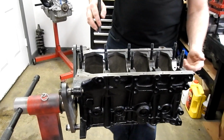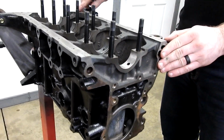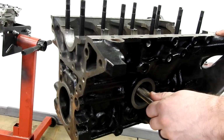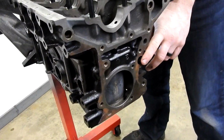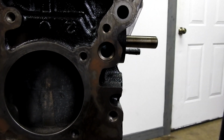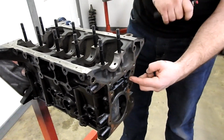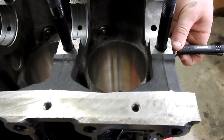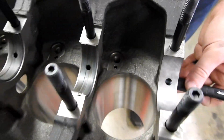On the BP motor, the oil pump inlet is here, and it sends oil through the block to the oil filter. It goes through the filter and back in and enters this main manifold inside the block. And we can see light coming through that manifold, maybe all the way down. From this one main manifold, we have 5 runners that come up to each of the main bearings, and 4 runners that come up to each of the oil squirters. And we can look down and see a light down each of the oil squirter holes. And we want to make sure that there's absolutely no metal in the motor.